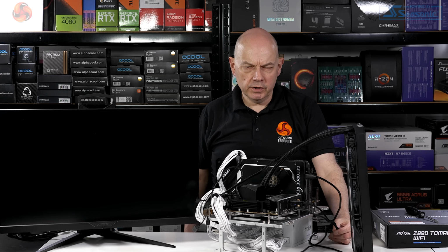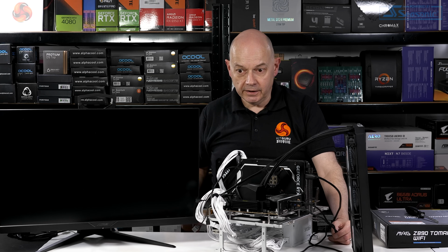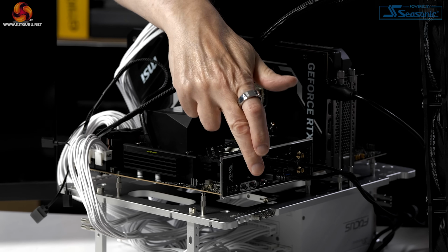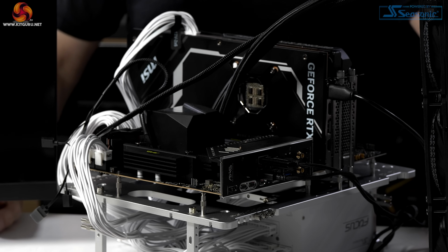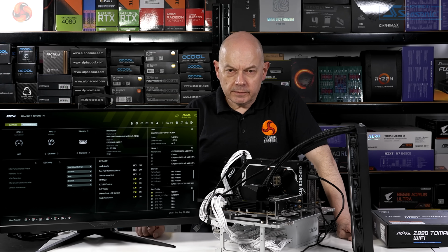If it doesn't work, it would flash probably 5 times and go out. So this appears to be doing something, and when it stops flashing, the update has completed, and then hopefully we'll have a display on the monitor. Just turned off a light to give you a better look at that very exciting flashing LED. And there we are in the BIOS setup screen.